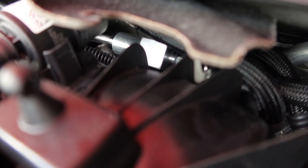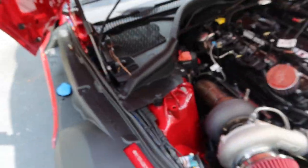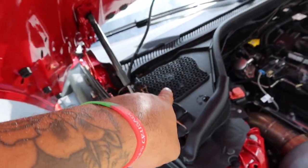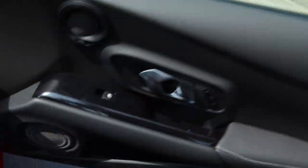That's the little fitting in the back hooked into the OEM fuel lines. We have this cable right here getting the MAP voltage so the controller knows what voltage it's at while tuning. Then for the RPM pickup — I actually used the same one from the nitrous setup — it's on the first cylinder, that white and gray wire tapped off for RPM. I have everything being wired through where the meth kit is.